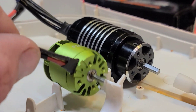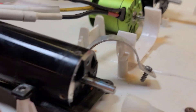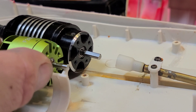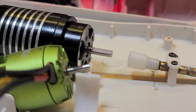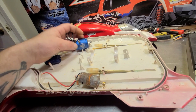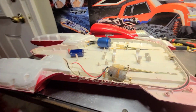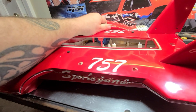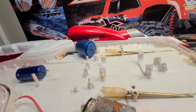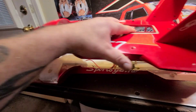But would it have the power to push this boat — that's the question. If I run the outrunner motor, I wouldn't have to do any custom cooling like I was talking about with the old-school wraps. I could just get a front-mount water cooling plate motor mount and be done with it, run a couple tubes and be done. Definitely can't put a 36-millimeter motor in it because the hatch isn't gonna fit on. Even with it laying down, a 36-millimeter motor with a water jacket is not gonna fit.